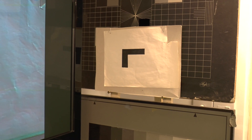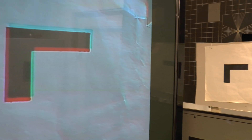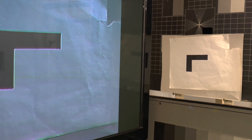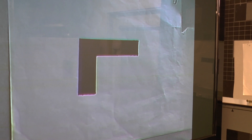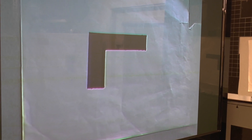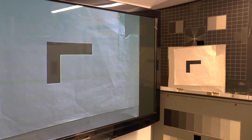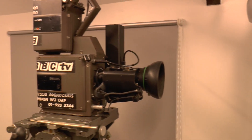So that's the registration chart — an inverted L — and when it's unregistered it can look like that or many other ways. I have to press the registration button, and these do have a bit of a reputation for either doing it or maybe not. That's what the auto managed, which isn't quite perfect, so I'm going to do it manual, which was pretty common in the days when these were used. Then that's just tweaking it in manual.